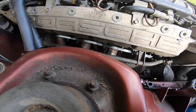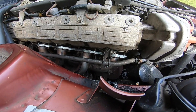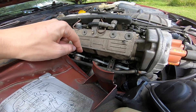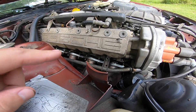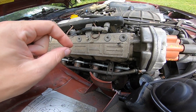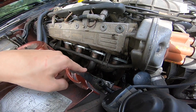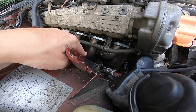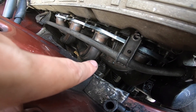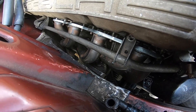The exhaust wasn't harmed or damaged. The Lindsey Racing 944 NA MSDS headers are in - not fully yet. I still need to pull them back off, put the gaskets on, and then put the bolts back on. But if you have the same problem where it won't fit up through, that's definitely the best way to do it. Just the top bolts on that engine mount - take those out. There are little nuts down below them too, holding them in. Those also come out. Those are 13 millimeter.